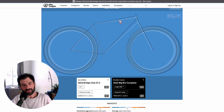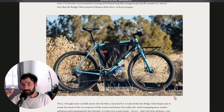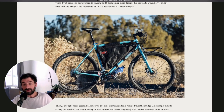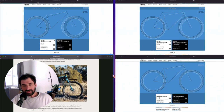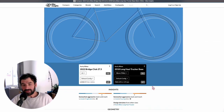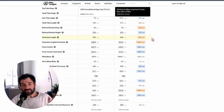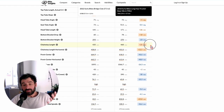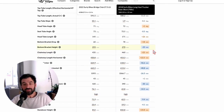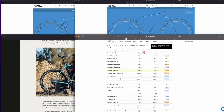The Bridge Club has a slightly more traditional-looking main triangle, thanks to the non-suspension-corrected geometry giving the top tube a less pronounced slope — perfect for fitting a large frame bag. The chainstays are relatively short for a touring bike: compared to the Surly Long Haul Trucker, the chainstays are 25 millimeters shorter on the Bridge Club, making the bike feel more reactive and playful but a little less stable when fully loaded.